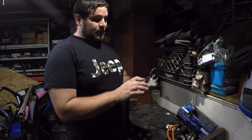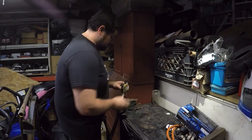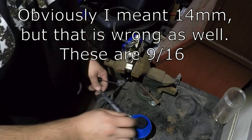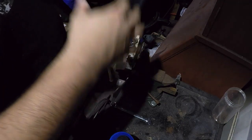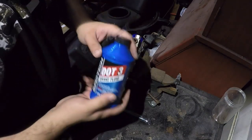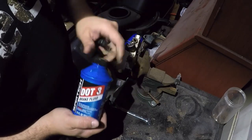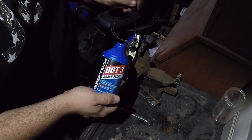Let's first get all the lines off, get the valves off, and I'm going to show you what I did to clean it. I'm going to need a couple tools - seems like I need about a 14mm wrench to get my lines off. I'm doing this on my junkyard one just because I actually pulled the spare just in case I needed it. I am actually going to repeat this later in the Jeep and give you a quick walk-through when I do that. One tip and trick: use what you got in front of you. You can actually use brake fluid as a penetrating oil to break up rust and crud that's on your lines. I'm just using a screwdriver and putting a little bit on there because you don't need a lot - just enough to get on the threads and let it seep down.